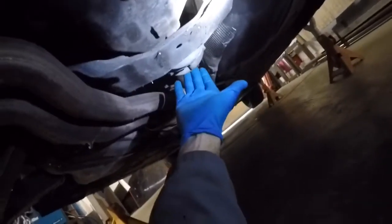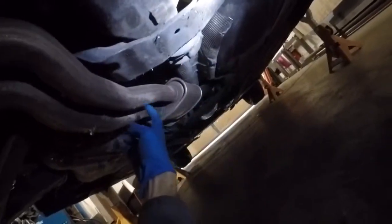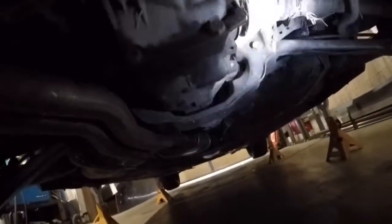As you get ready to do all that, the first step is you want to make sure that you pull the driveshaft out first and remove the exhaust out of your way, because this entire rear subframe back here is coming out. So I'll pull that out and then show you what we're actually plating up there.